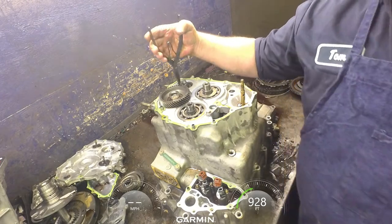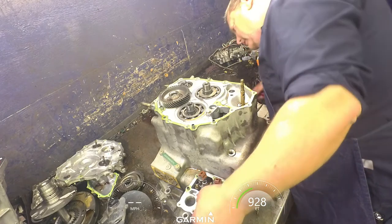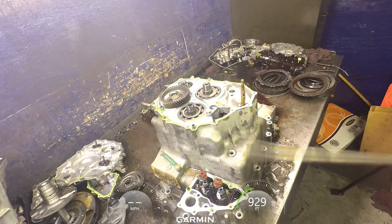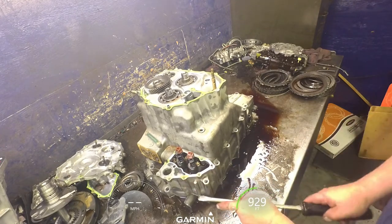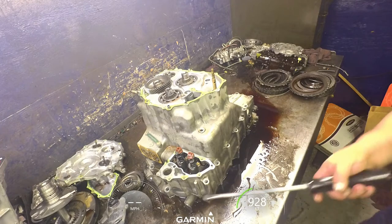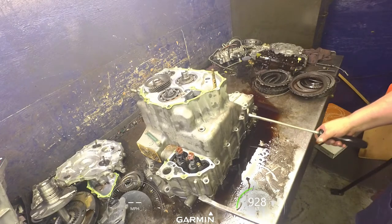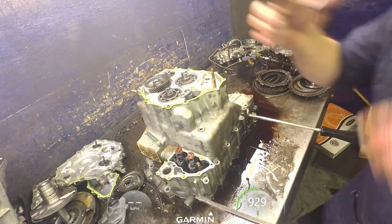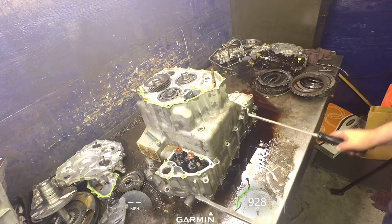And the bearing's going to stay. Go ahead and loosen this case a little bit. Find me a spot to hit on and pry on. We got a spot right down here that we can get, and a spot right here. Get our snap ring spread. There we go. It dropped. Now our case should come off.